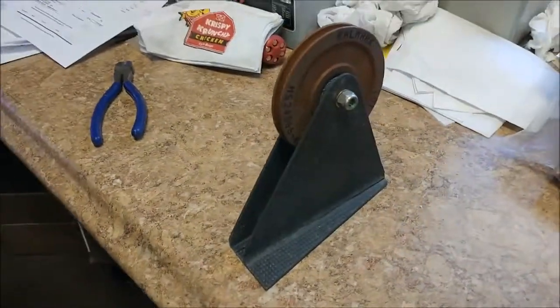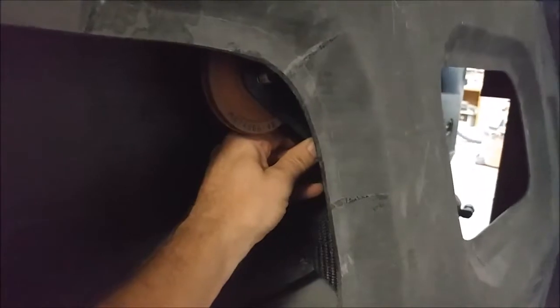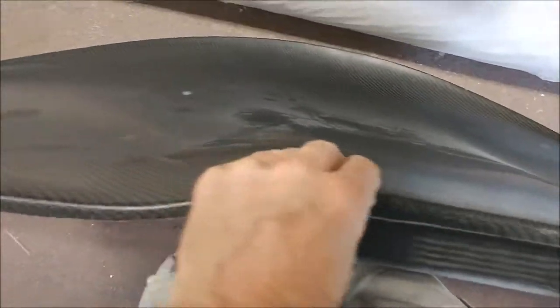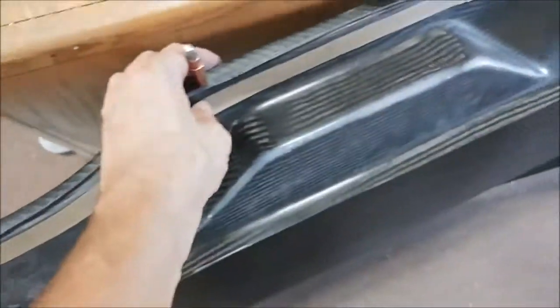Here's another bracket Jeff did — this one sits up behind the aft bulkhead. I'm holding it in position to show where it lives; the other one feeds up to this one. If you look back in the previous videos from a week or so ago you'll see how it all was laid out. Next I was cleaning up the glare shield and the glare shield underside, getting them ready for bonding — we're going to bond the two parts together.